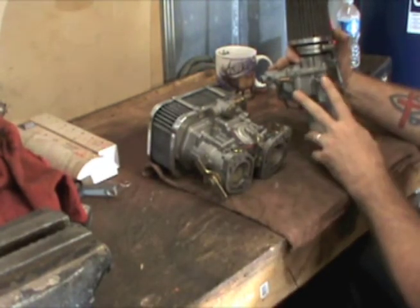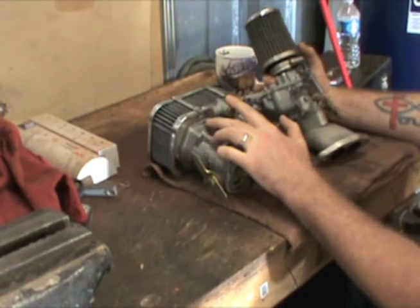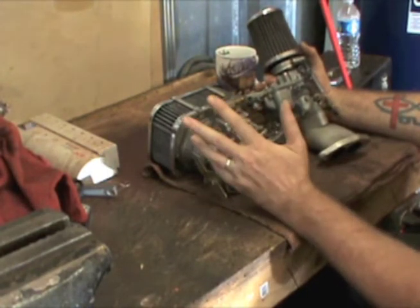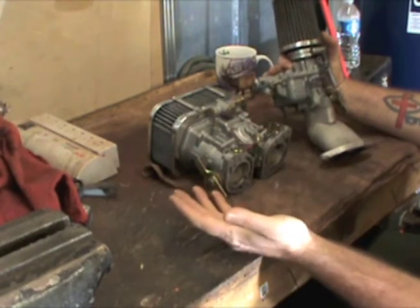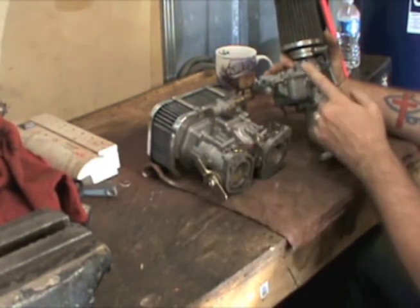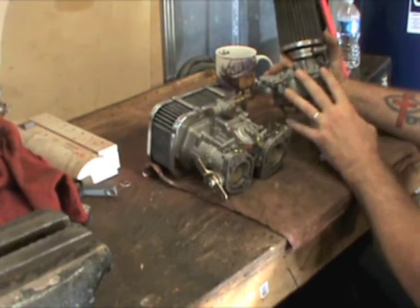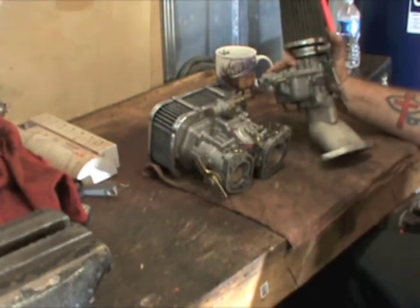The ICT works really good on smaller motors. Say you're building a 1641 or even a 1600cc — I'd put a set of these on there without hesitating. You can get jets and jet them up to fit a little bigger motor too.